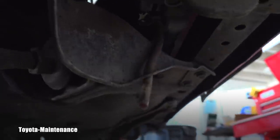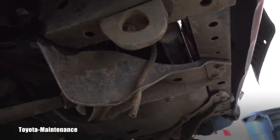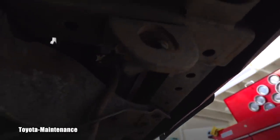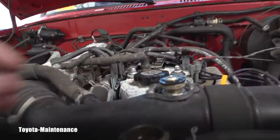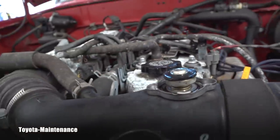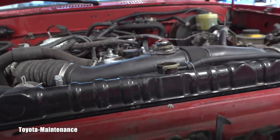This will be a long-life coolant, and it's slowly leaking without me doing anything. Hopefully we have great news for the owner. I will drain the radiator and replace the o-ring on that valve, and hopefully that will stop the leak. I will also replace this deteriorated cap — it's junk. You replace the whole cap for about ten dollars, and hopefully that will solve the problem.